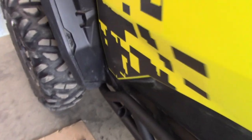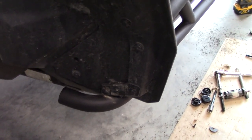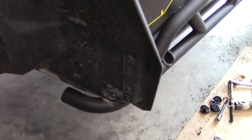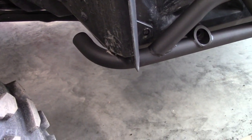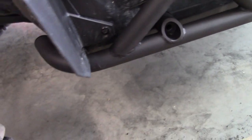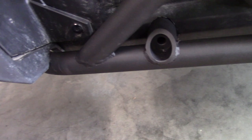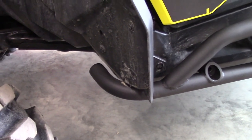Now that I've got this marked out, I just threw a guide hole through the bottom of the fender there and chiseled this out. Got a little hole there — I'll just take the little angle grinder and round those out and it should pop up in there no problem. It looks funny now but wait until we're done. We're at the point now — we grooved that out, gave it a nice concave roundness for that to slip in there nice and easy. You can see that comes out around the front and curls around there, which is good protection-wise.